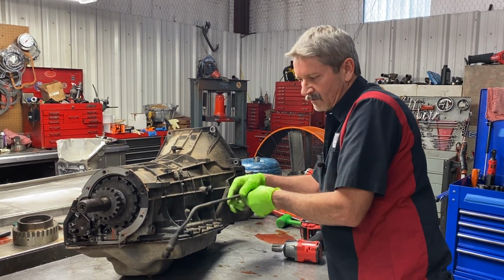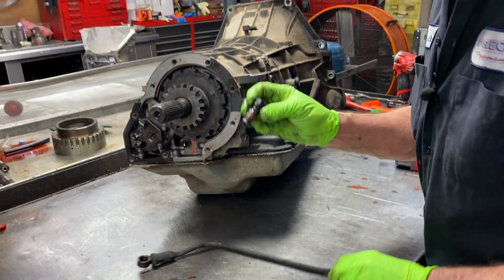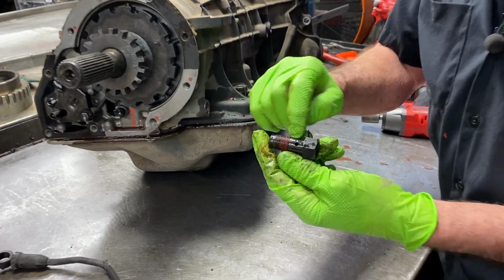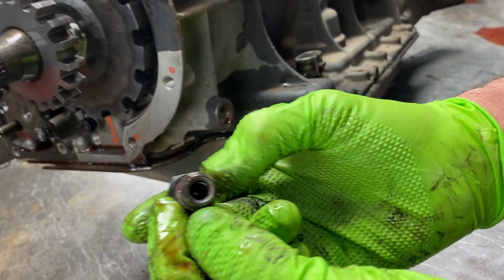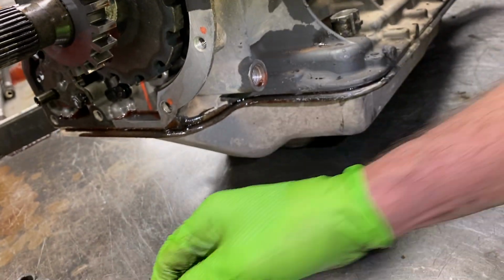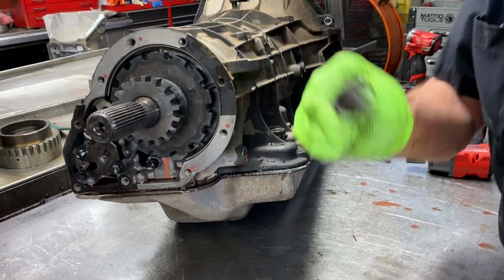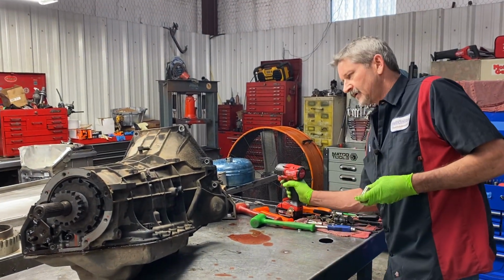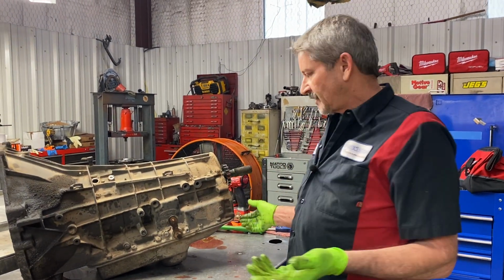They'll come with new bolts, gaskets, you know, they'll come with everything. Now some of them might not come with these, but every one I buy comes with it because there's a spring and a check ball in here. This is a one-way check valve. Can you see that down in there, Trent, that ball and spring? So, now also, there's another one in here. So that's why we replace these, because that's a very critical area where a failure can occur, and it'll be the worst type of failure because it'll restrict the cooler where it actually melts the gear train to the ground.